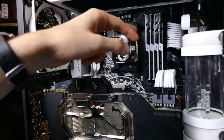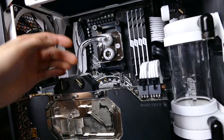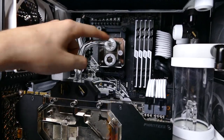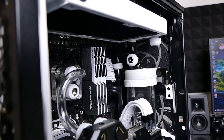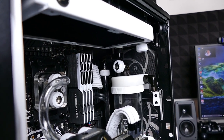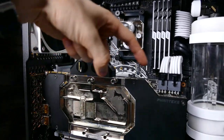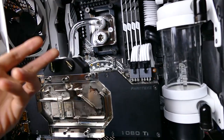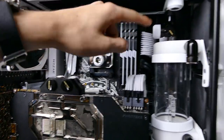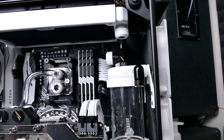This next bend is going to be a little tricky - it's kind of like a two-point turn. But this pipe is kind of in the way of this run; it's almost level with this pipe and about the same distance back from the front of the case. I might put a 90-degree fitting in here and have it jet off this way, but I feel like that would look silly. And keep in mind we also have to have a run from the CPU up to the port on the radiator.